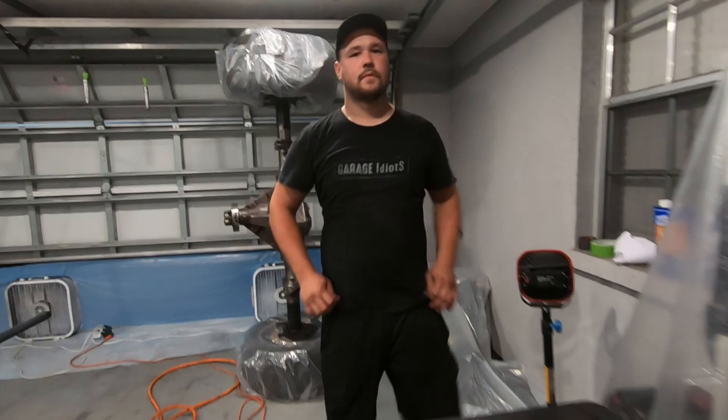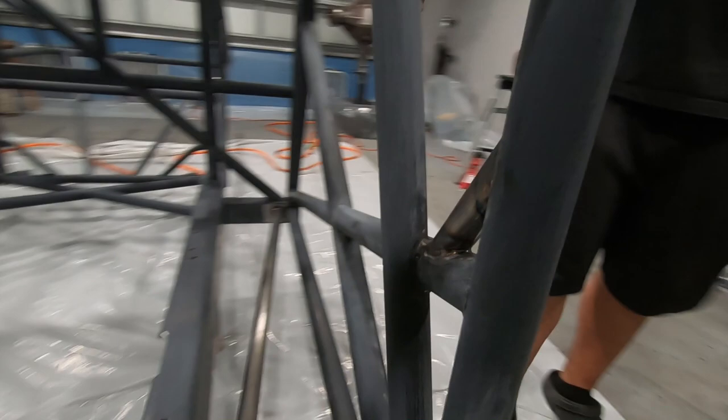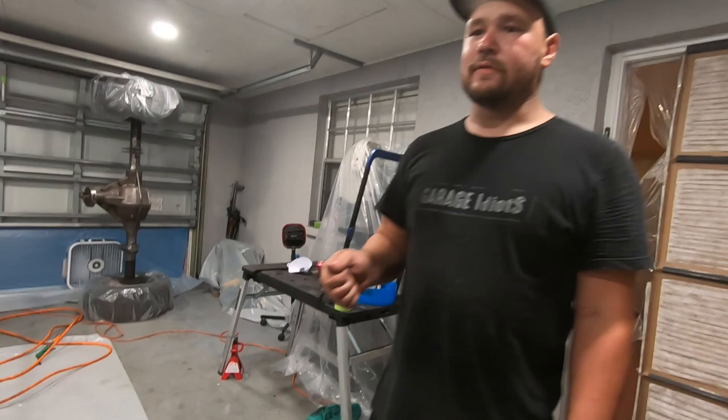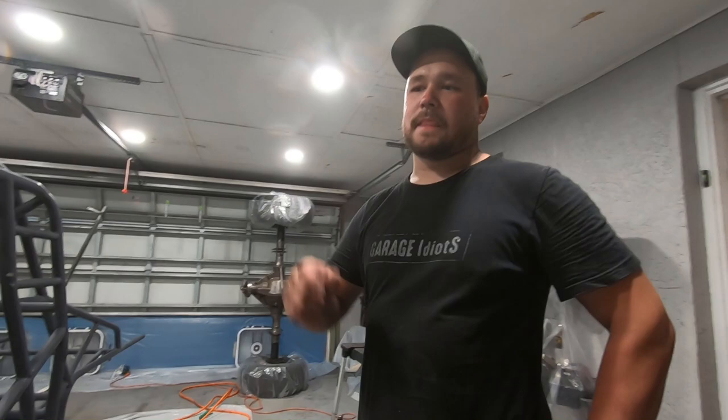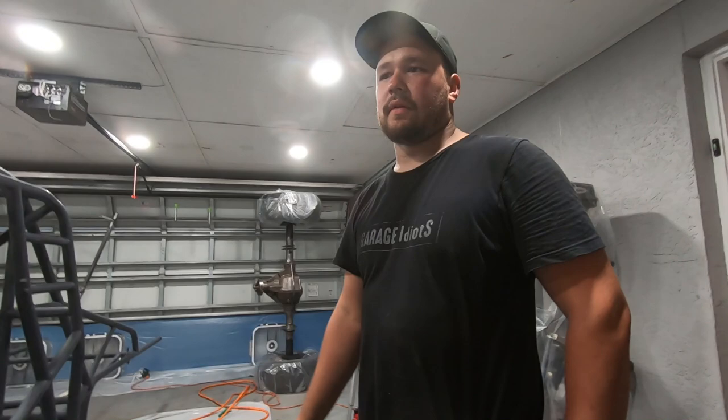Got the chassis done, everything's blown off and wiped down, so we're going to mix up some primer and hit all the bare areas - like these gussets and these bottom door bars. We'll hit those with some epoxy primer just to seal them because it is bare metal. Once that's done, we've got about a 15-minute flash time, and then we're going to add the Eastwood single-stage paint - their Rat Rod Satin Black. We'll probably reduce it down a little bit so it sprays out of the gun nice. This time we're going to narrow down the fan pattern and reduce the volume of flow quite a bit, so hopefully we don't have overspray and can use a lot less paint. The last time it took a gallon of paint to do this thing, and I've done a whole car with a gallon of paint.